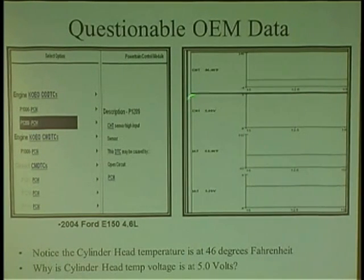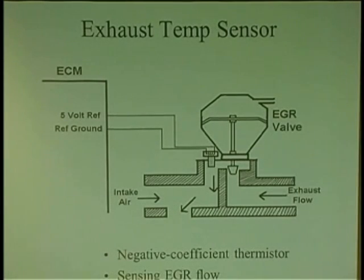So, and look what the scan tool has, an extra pin. Coolant sensor, 5 volts. If it actually substitutes a value, it'll usually give you a second PID, a voltage PID. That's when you know it can substitute a value. So understand about substituted values. Don't be fooled by them.